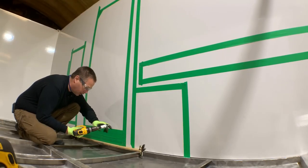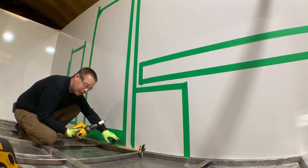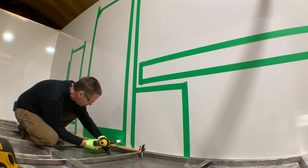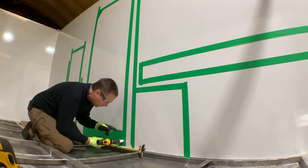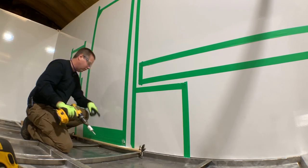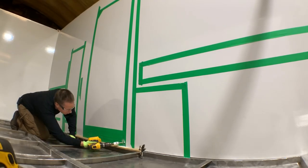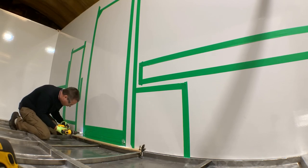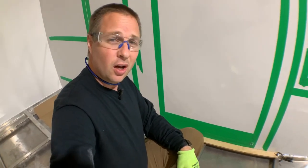I'm going to start with the bottom corners. Even though this is a square corner on the door, I'm going to do it with a radius because I don't want any area for stress to concentrate in the fiberglass that could result in a crack. I just punched through the other side, going far enough to cut through the fiberglass shell. Not much left to do but cut. I've vacuumed up the dust from the inside, went outside and checked, and the holes appear to be where I want them to be. All that's left is to punch a saw through the side of my truck.